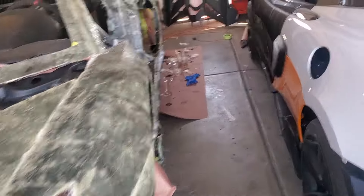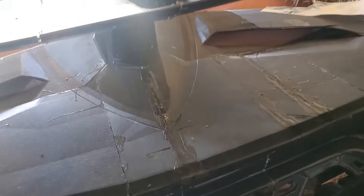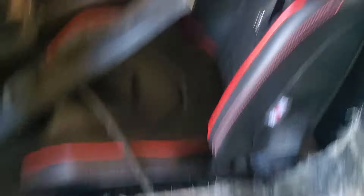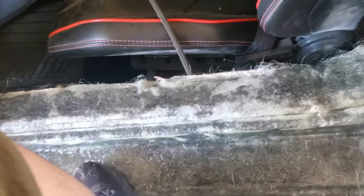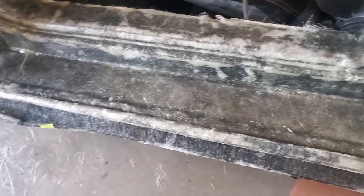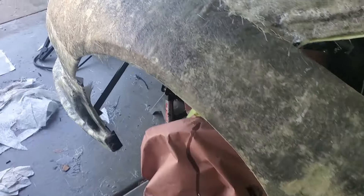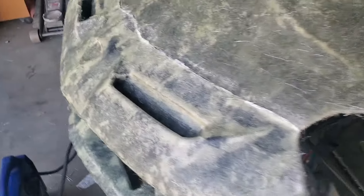The next thing on my list — we just keep moving back. I'm not going to do the bumper just yet, but I will do the upper fascia as well as the wing. You can see how wobbly this is — anytime I lean on these 3D prints they go crack, crunch, crack. But I can actually put my foot on this one and I cannot hear any of that. If I were to do that earlier without the fiberglass, it would have just broke. So the stuff is working. It's giving me the support I want for the 3D prints — they don't need to be super strong, they just need to be able to not crack when somebody leans on the car.